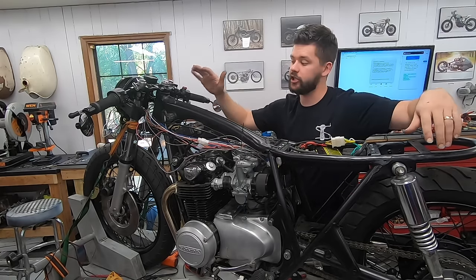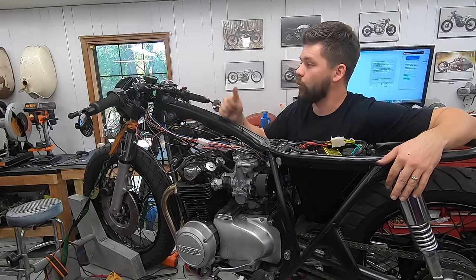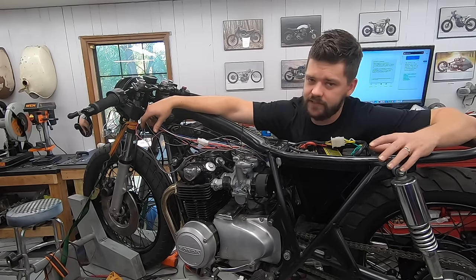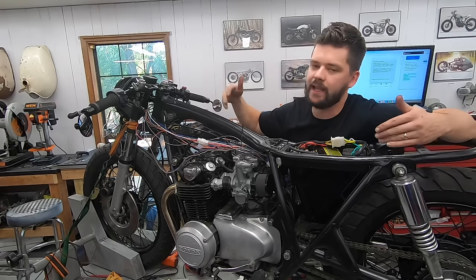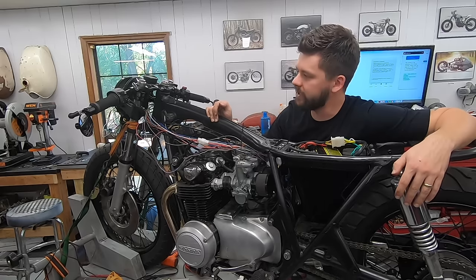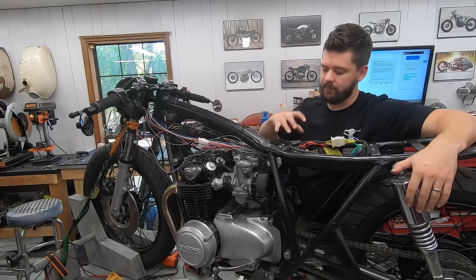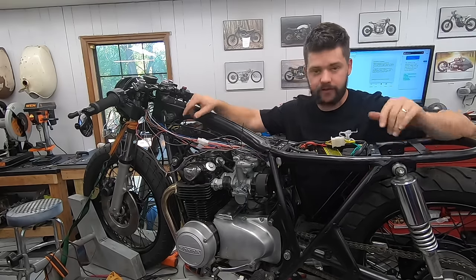I really hope that this helps you guys if you're changing over your classic Honda to an M unit and you want to utilize your factory switches. There's a couple of reasons why you would keep your factory switches — one is if you're trying to keep the bike somewhat aesthetically stock. Also on classic Hondas, the right switch is part of the throttle assembly, the left switch is actually where the clutch mounts. So you can obviously get a universal clutch mount and universal throttle and change it — it's definitely doable, it just adds more expense. So this is a good stepping stone if you want to switch your bike to an M unit and then maybe later on change up to different style handlebar buttons. The beauty of the M unit is all that programming is constantly updatable — you can change your setup, you can put this on a different bike, you can add and remove accessories. Once you get the main system set up, all the rest is gravy. So I appreciate you guys watching as always — make sure to go check out the guys at Revival if you want to get one of these for yourself. And I'll see you guys in the next one.